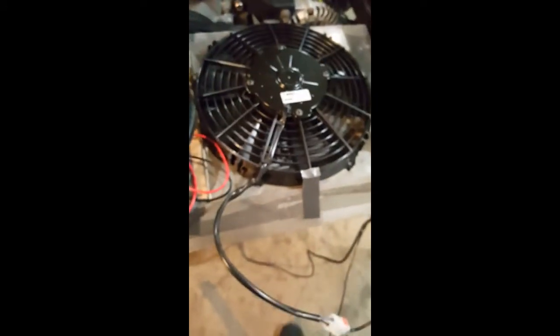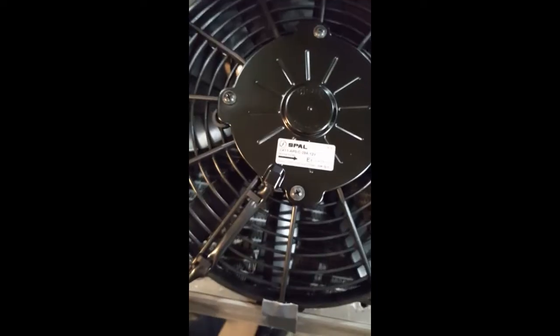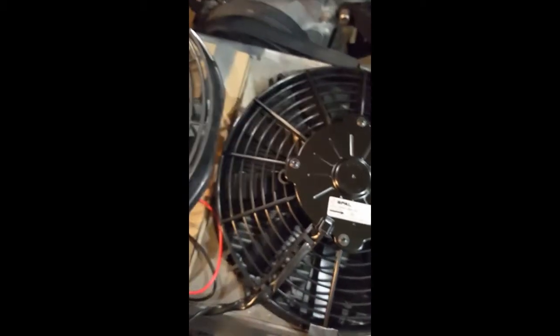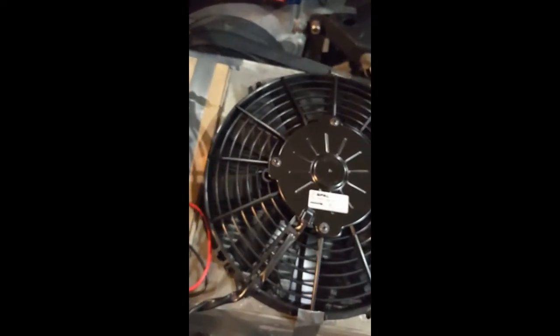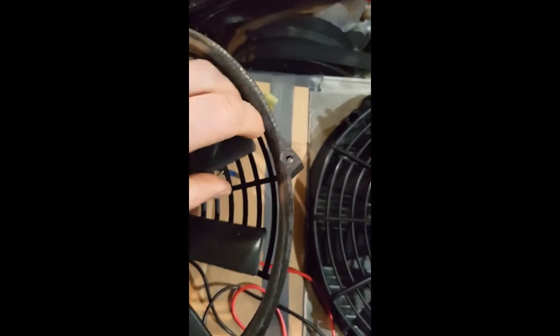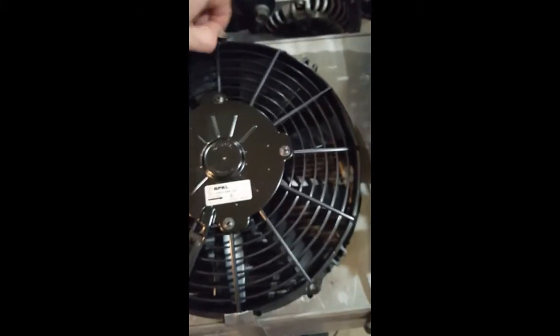The Spal fan has more dimension to it, so hopefully I won't have that problem again — that's what motivated me to get the better fan. Other differences: the motor is clearly different, the back is different, and blade design looks similar although these blades are a little wider. One difference that could account for a lot of the performance change is the gap between the fan and the cowl — you can almost put a finger in the eBay fan's gap. On the Spal fan, it's a much smaller gap, so it seals better and the air management is just better.